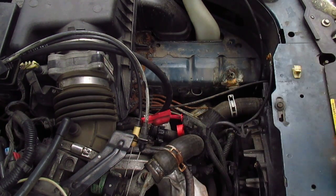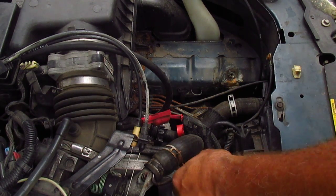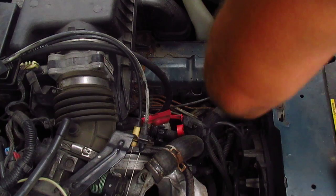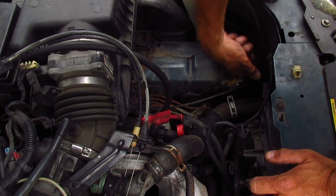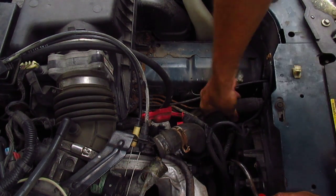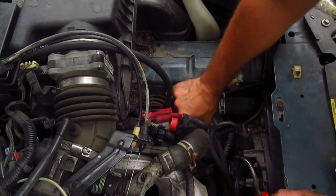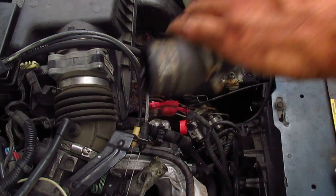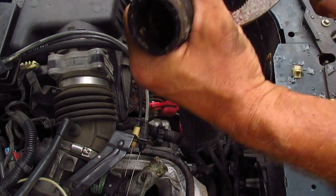I don't really know why they use these spring clips, but it must be easier at the factory than having someone sit there with a screwdriver or nut driver. Then I've got this little hose tool — a pick — which is a great tool to have. Helps you get the hose off. Now if you're doing this repair with antifreeze in your system, you've got to run a catch pan and dispose of the antifreeze properly. All I have in this system is water, because I knew these hoses were going to leak eventually and it was summer. So there's your old hose — very old, very flexy.